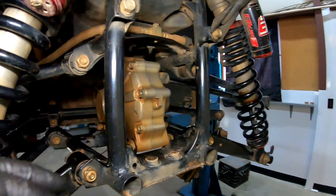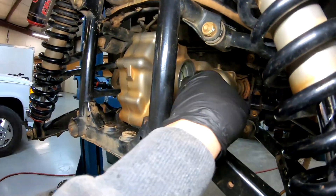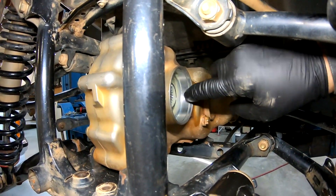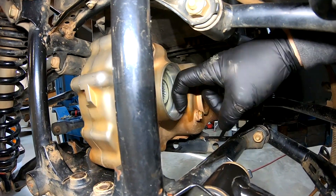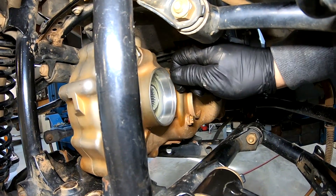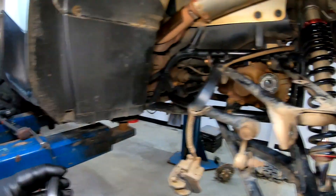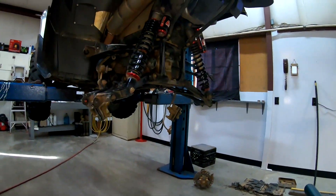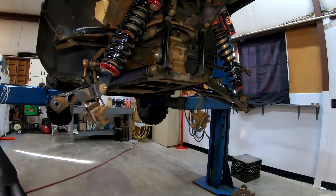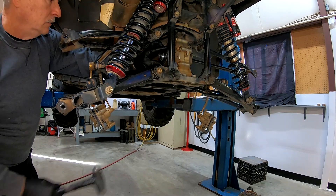Alright guys, I got that wiped out a little bit. Like I was talking about that edge — on this side here there's a shoulder right down in here. So this seal will probably bottom out on this shoulder, and then you have that edge we were talking about. So that seal basically fits on that spot right there that's smaller than the outside diameter. Since I don't have anything like a seal driver, we just have to get a hammer, start them, and drive them in there.